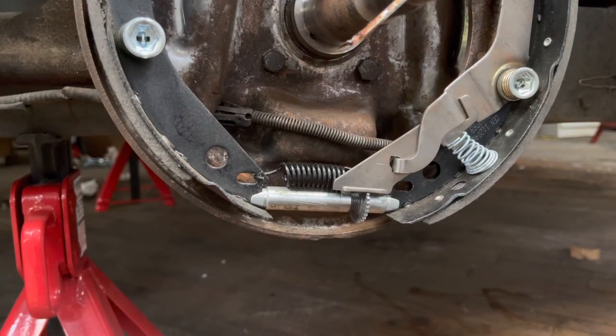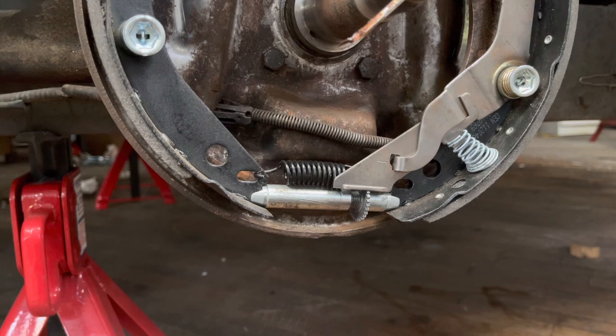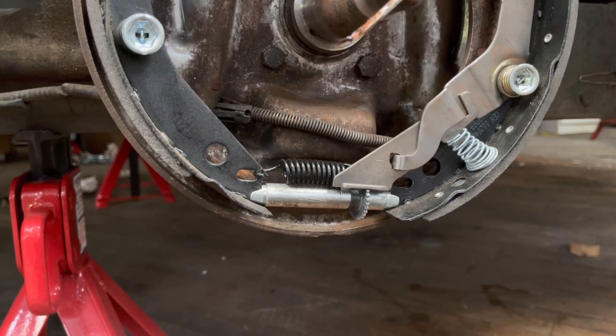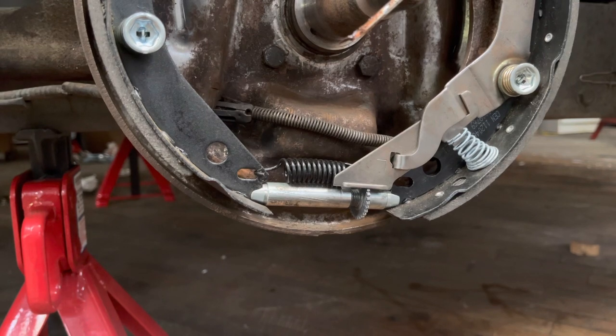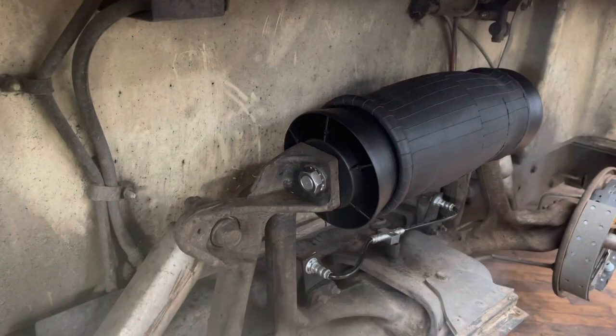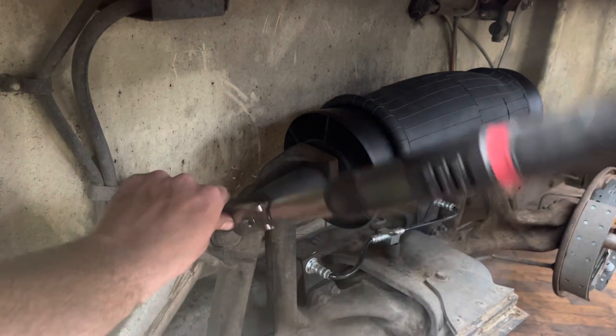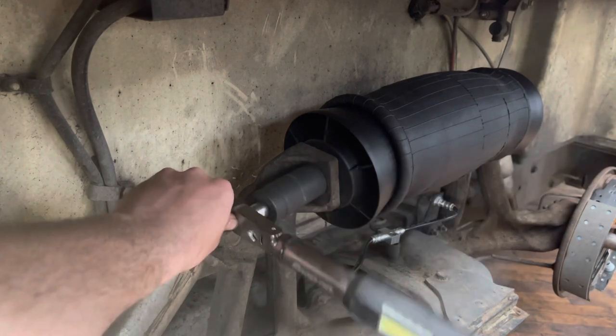You can place the jack on this area or on the brake drum itself, because you're not jacking up the weight of the coach — only the weight of the bogey arm. Just be careful and don't force anything and don't bend anything. The torque spec in the factory service manual is 50 to 60 foot pounds. I'm going to do mine at 60, so just put on a socket with your torque wrench and torque it down.